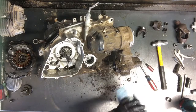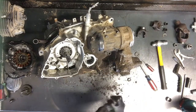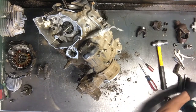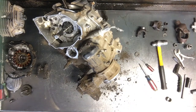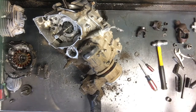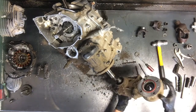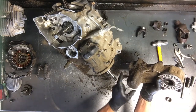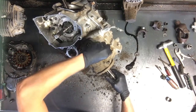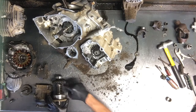Now we will pull the middle drive gear assembly off. Here's the cover with the transfer gear in this area — this will be full of oil or should be. There are four 12-millimeter bolts and three 8-millimeter bolts on the case. The case assembly is off — there are gears down in here that are free. This will have oil in it. Here's your filler hole and here is your drain — it's a 10-millimeter drain on the bottom. We'll let that drain, pull this cover off, remove the shaft, and remove the transfer gear. These transfer gears are bevel gears — they work together.